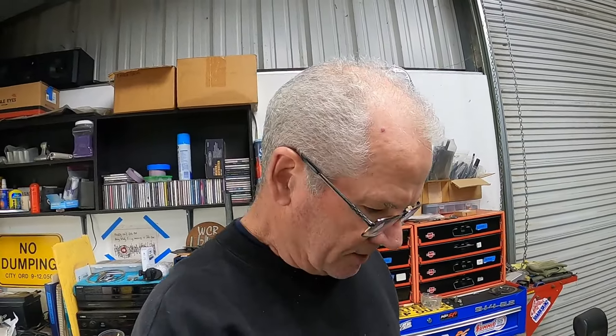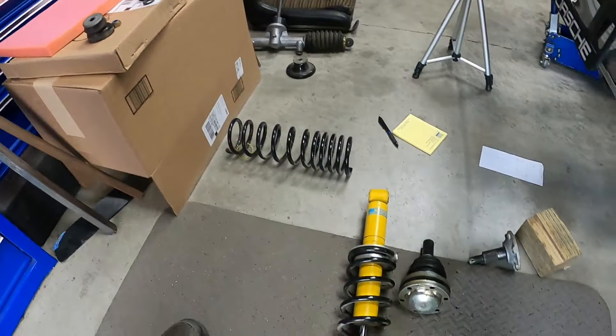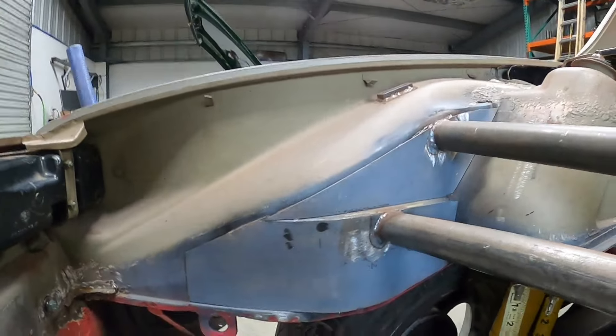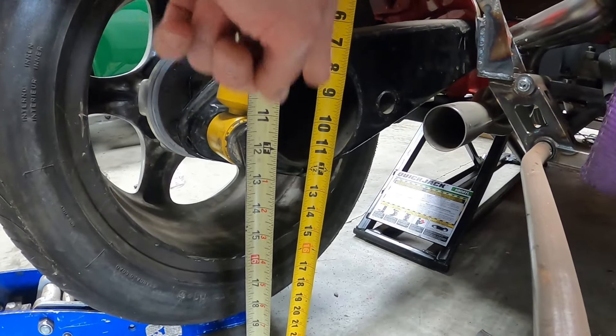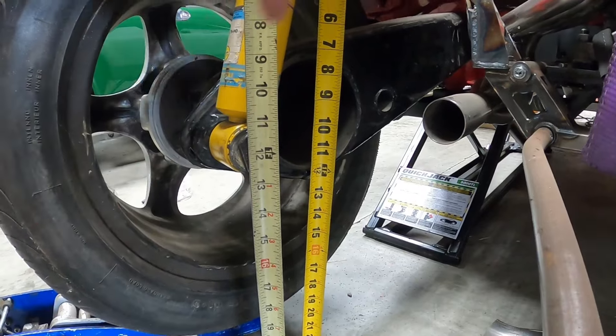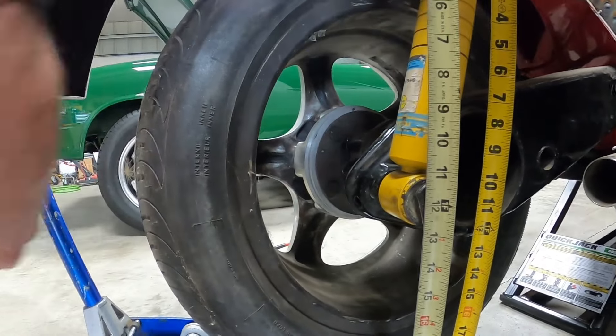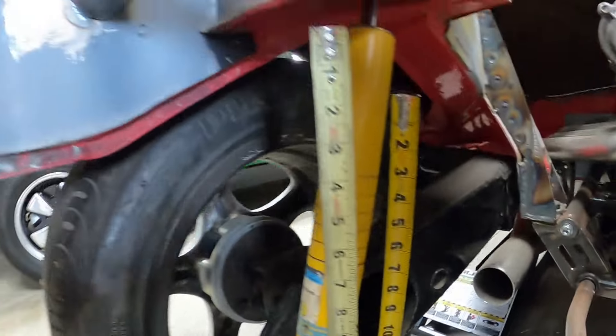After having this conversation, I think I can make this car — and maybe my LS car as well — work a lot better suspension-wise. He gave me some homework: pull one of the shocks apart, get the spring off, put the car up, and measure every inch of wheel travel. For every inch of wheel travel, measure how much the shock moves. I've got a very unscientific model — I've stacked up a couple of tape measures and I'm just going to jack the wheel up each inch and measure shock movement.